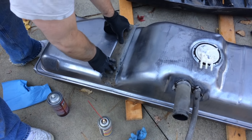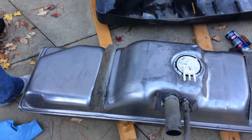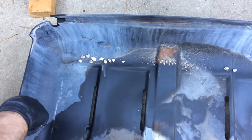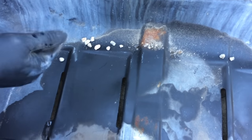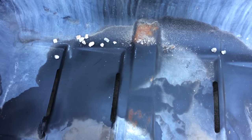We're almost ready now — going to move the new tank into the shroud, but first I want you to see what the cause of the leaking was. Once we got the old tank off, you can see there are a number of small stones that over the years worked themselves into the shroud itself. The ones that were rubbing actually caused the problem — this is the source of the leak. Looking under the tank, you can see from the drip stream that this was the problem. It's great that you have these vents to get water out so you don't have corrosion attacking the tank, but sometimes these stones get in and cause this problem as well.